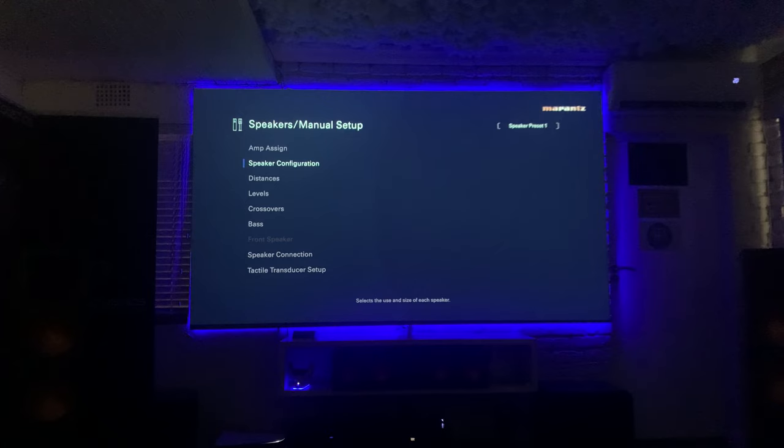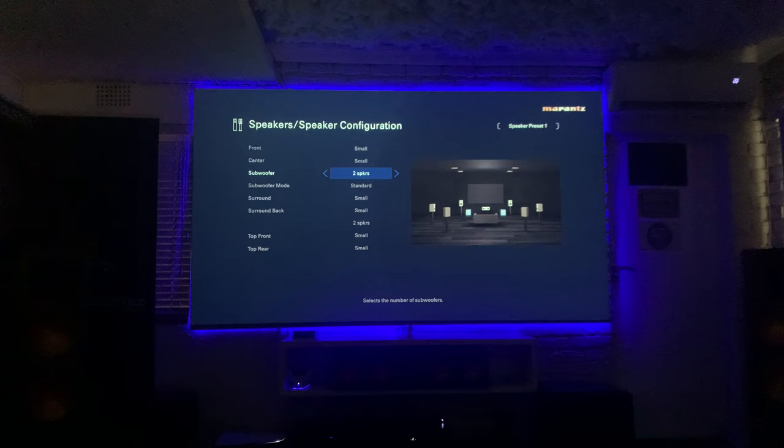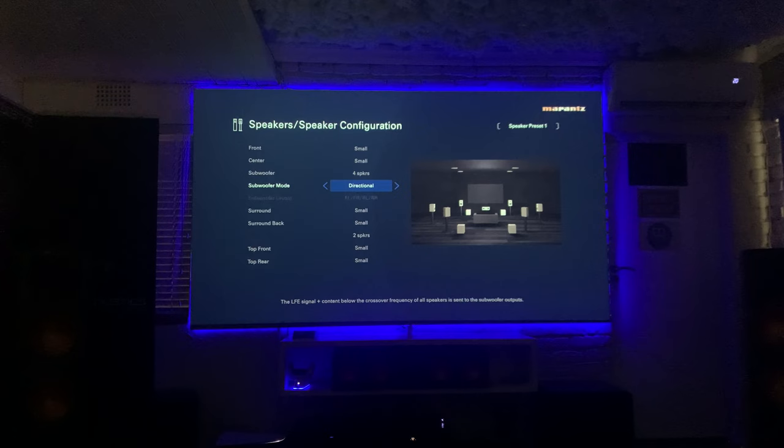Speaker configuration, subwoofers, we will now change to 4. Subwoofer mode, we will go directional. You've got standard, where they all get the same signal, or we will go directional. I feel if you're not going directional, you're sort of not using all of it to its full potential, so we will go directional. And that puts it front left, front right, rear left, rear right, the way they are. We have all the speakers set to small, but the calibration, we'll go through that again. I will not be able to show you what I do. Well, I might be. I use the app. So next video, I'm going to set up the mic and we will dig into this a bit deeper.